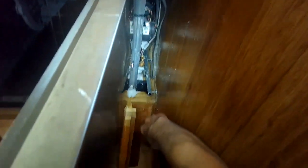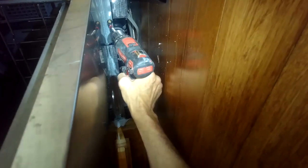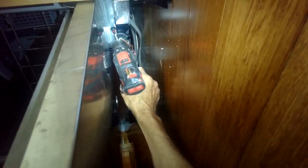There are two gold quarter-inch screws that we need to remove that are holding the control panel in. I'm going to pull off this one little modular connector below the control and zip out these two screws. By having the door fully open, if you have long arms like me you can reach and start to get to these two screws.